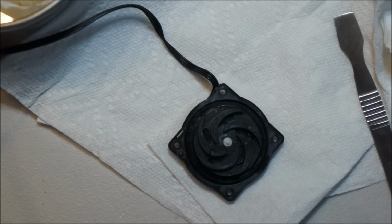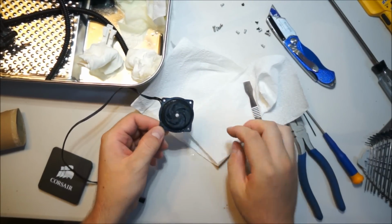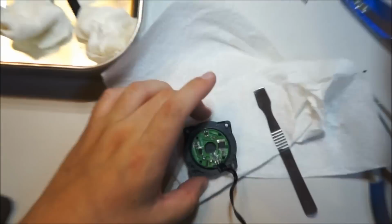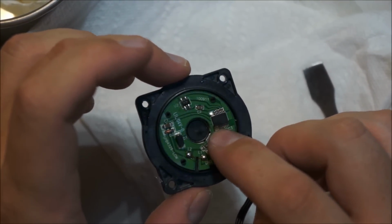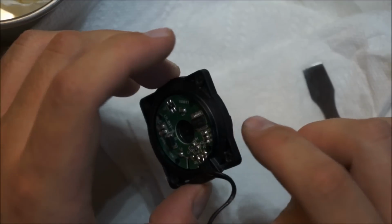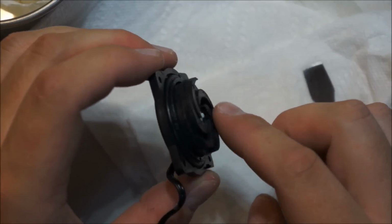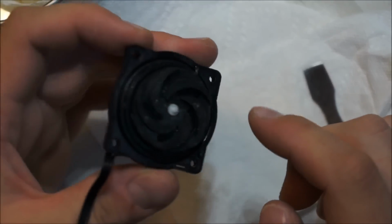Well, there you go. So that's the interior of the actual pump on a Corsair H60 water cooling system for a computer. It's interesting, you can see that this has some of the pins on this, whatever the controller in here, are bonded. So presumably those are the power device. This may in fact be only a single phase, like most computer fans are. They just energize and de-energize it in pulses. And then they just rely on the mass to coast between segments. Well, there you go.